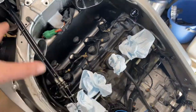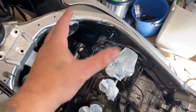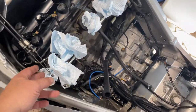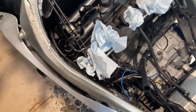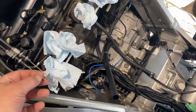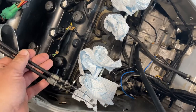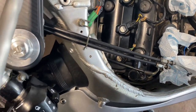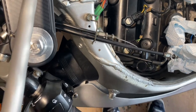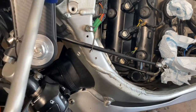If you were doing this with your fully built bike, you'd have to take the tank off and take the airbox off. Then on the carbs, these cables will be attached on the side. You just unscrew until it comes out the top, then they'll unclip, and you want to just feed them out. We're doing one at a time, so I'll take this one out first.